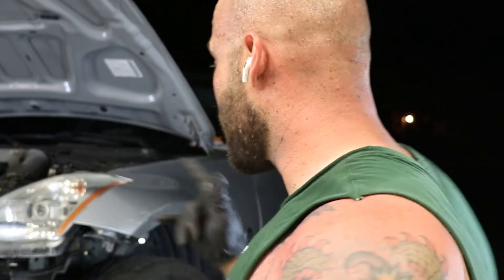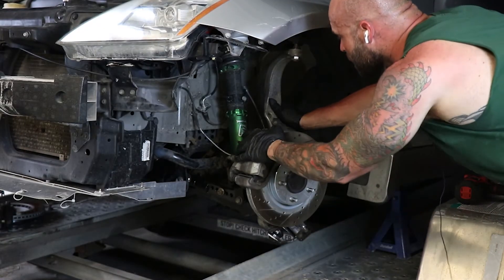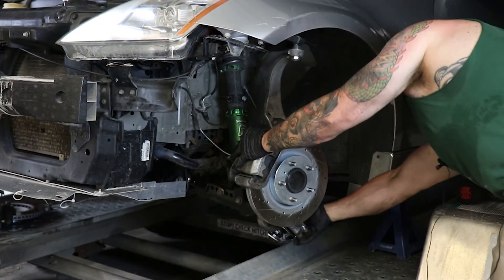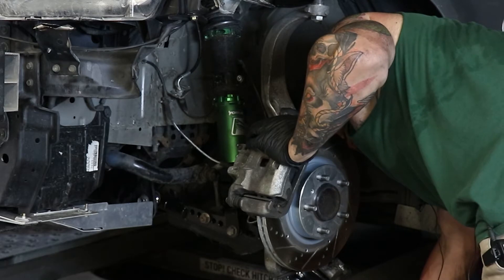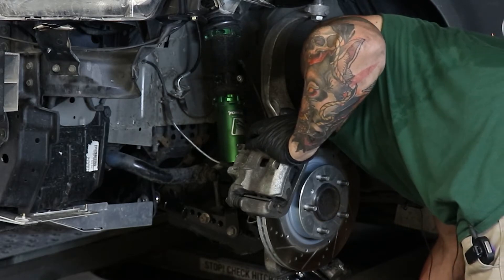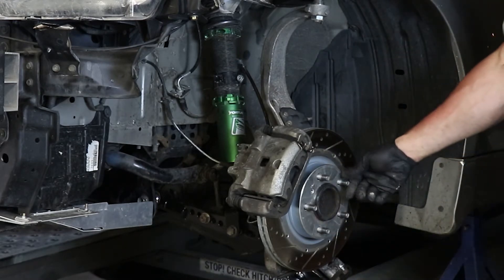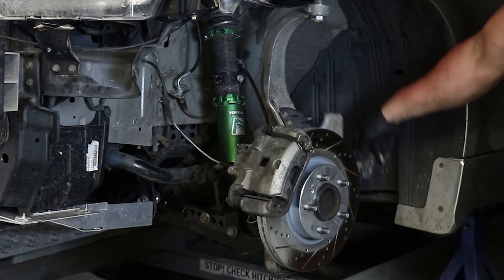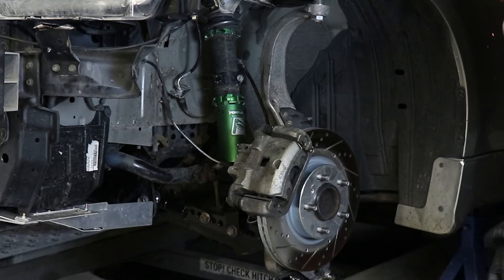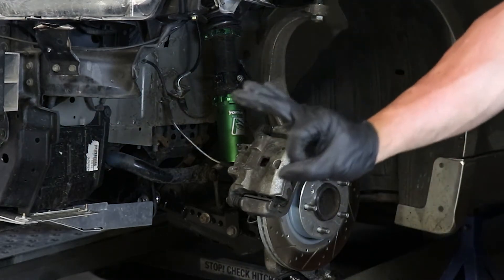I'm going to go ahead and take off this side and see what the damage report is. The coilover appears to be fine. The brake is fine. The steering wheel is not locked, obviously, because there's no tie rod. It looks like everything survived except where the hub mounts to the upright — that's snapped. You can see it here. The tie rod survived somehow too. I have no idea how that cracked, but aluminum. Pretty okay overall.